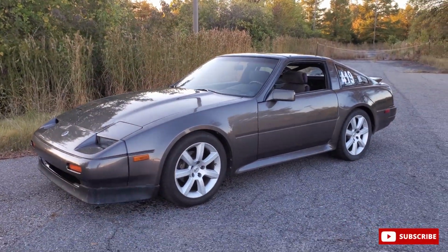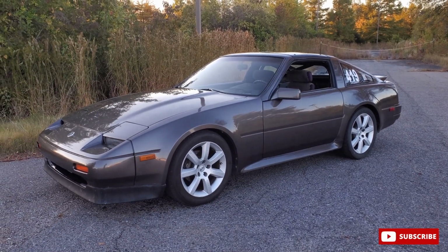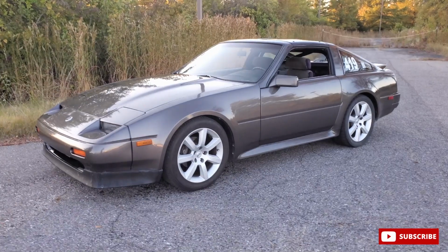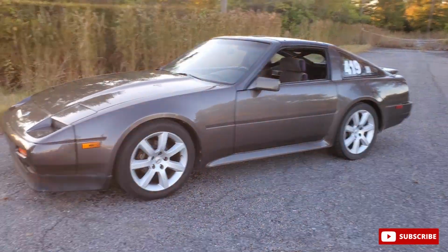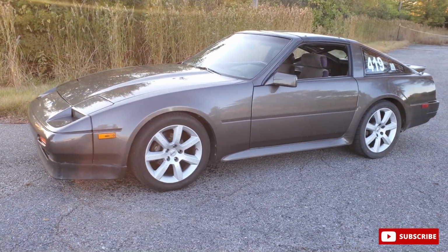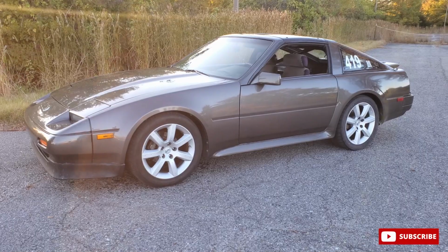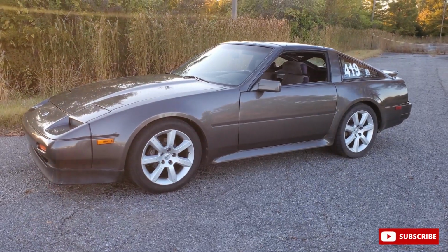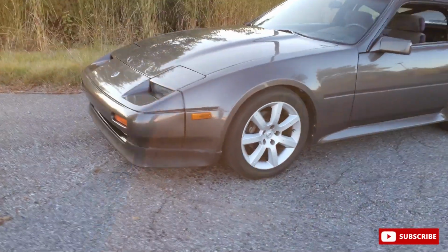This is my 86 300ZX. Never done a mods video, so I figured I'd go over some of the major mods that have been done to it. It's a factory NA body which started out to be a turbo swap from a factory Z31, and now it's got a relocation manifold, but I'll show you that in a minute. The front end has been swapped to an 87 front end.